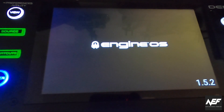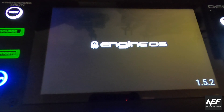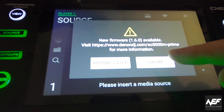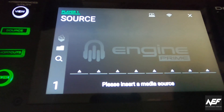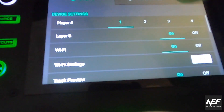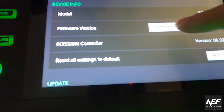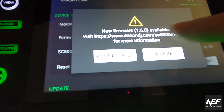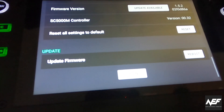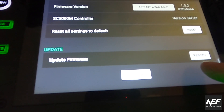When the player has booted up, you have to dive into the menu to reboot it. You'll see a notification that there's a new firmware available. Press view, go to the utility menu, and scroll down to the bottom where you can see the actual firmware version and that an update is available. Unfortunately, the update process doesn't work over Wi-Fi — you have to reboot the player in firmware update mode.